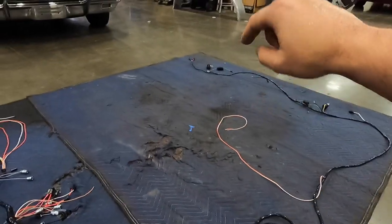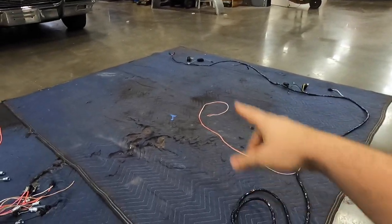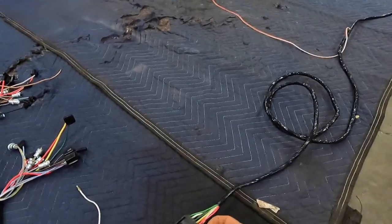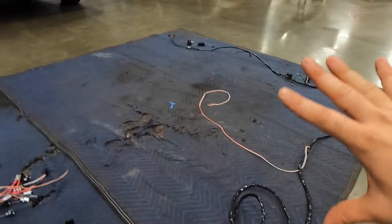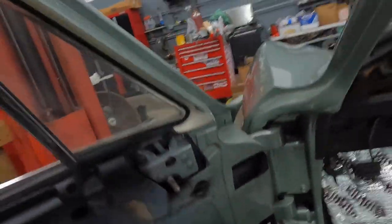So it can be logically said: if you have problems with any of the turn signals, running lights, fuel tank gauge, license plate lights, or dome light, all of that shares the same connector. If you have problems back here, I would probe both sides of that connector to make sure you have continuity — that will more than likely steer you in the right direction. This connector runs along and will be found in this area, with a holder here for a circuit breaker for the headlight motors.